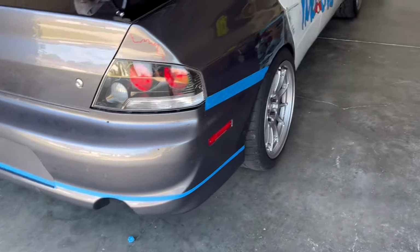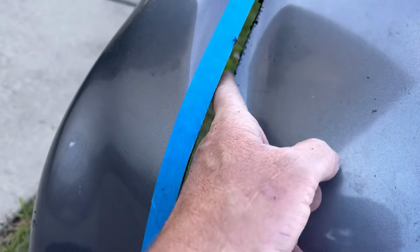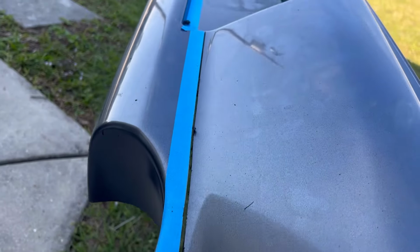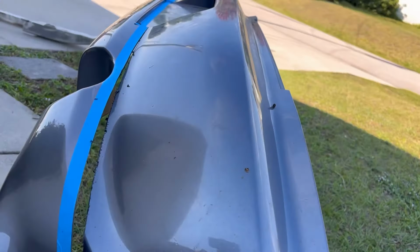I think the best tool for that is fine tooth oscillating tool. I would use a grinder, but it kind of melts. So I think the oscillating tool is a trick, but I'm gonna grab both tools and start playing with it. Oscillating tool seems to be doing the job without sending up tons of melted shards. There's still some that can file down. Well, let's get a nice clean cut. Clean enough for a race bumper anyways.